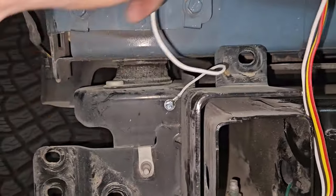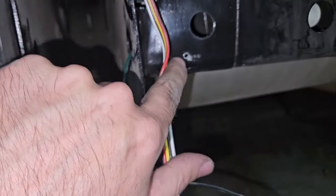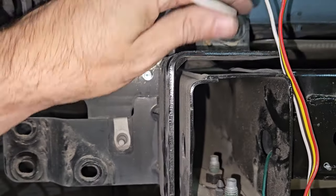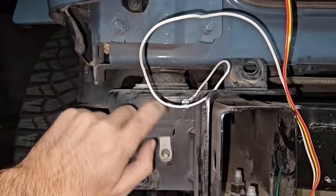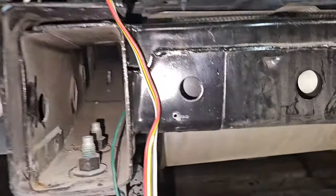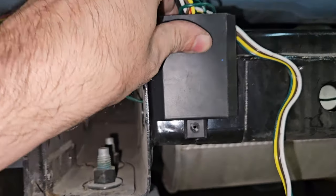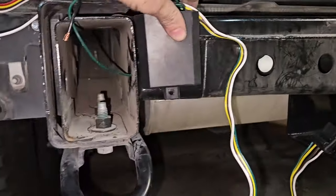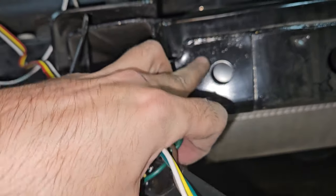I got the ground right there — I ended up drilling a little bitty hole and running the screw through it, because I feel like it's more solid ground than the body. This is the frame so I'd rather do it here than on the body and risk rust. I did the same thing on this side, and putting this here — on the back side, not on the heated side. I'm going to go ahead and put the double-sided tape on it and the screw just for extra security.